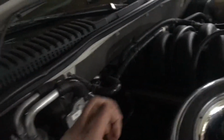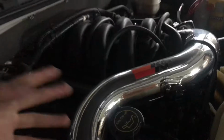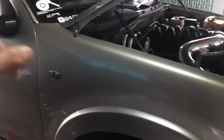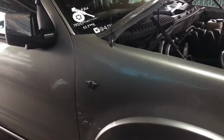The inlet. And what that does is it gives you the allowance to improve the fan speed. And that's why sometimes when you cold start, these are 4 gens, even the 4.0 models, they stay at low. Or even when you start driving it, after like 2 minutes, you see automatically, if you have the digital climate control, which I do, it just starts going up to like 4, and you really don't want it there, but it does it for you. Technology, huh? So that's what that check valve does.